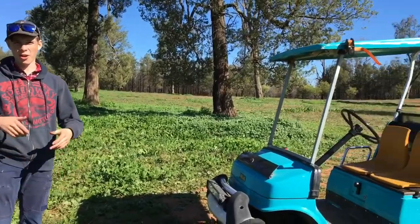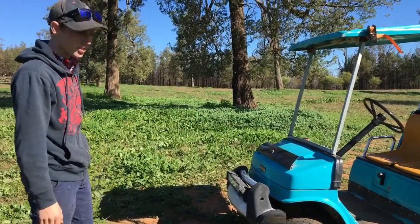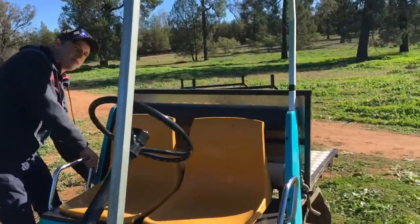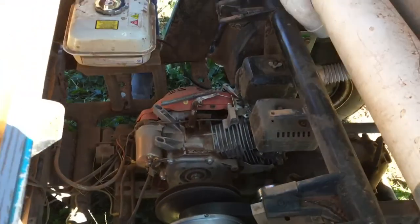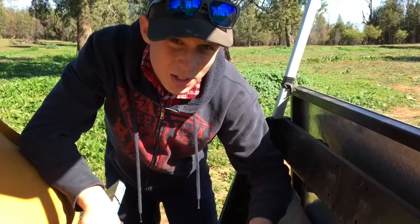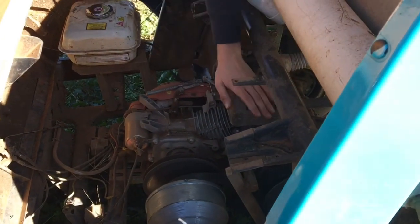Today we have the golf buggy. I know I said in the last episode I was going to do the Toyota Hilux — that's next weekend. Under here we have a seven horsepower engine; it looks like a Honda but we got a Chinese one and it runs pretty well. We had one in it before but forgot to put oil on the air cleaner, so it started blowing blue smoke everywhere and we wrecked the motor. So we ripped it out and got another $150 motor and put it in — haven't touched this one at all.